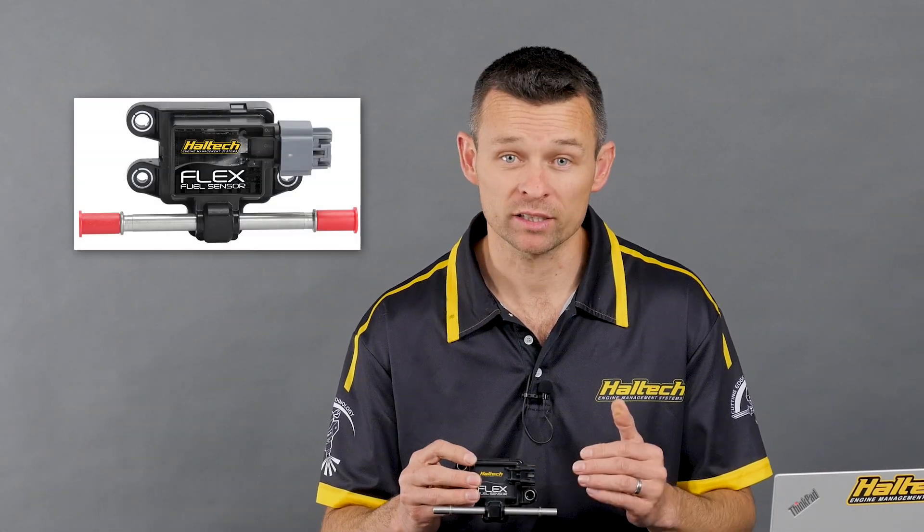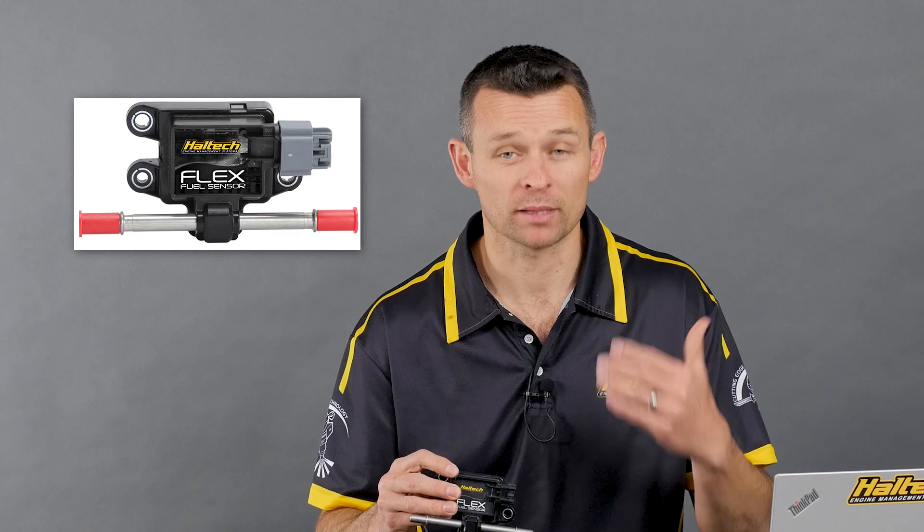And once that was done, we couldn't go back to gasoline without re-jetting the carb all over again. Now, with EFI, however, we can use a sensor like this — a Haltech Flex Fuel Sensor. When installed into the fuel line, it can measure the actual percentage content of ethanol in the fuel. So if you had half a tank of gasoline and topped it up with 100% ethanol, you'd end up with a 50/50 mix. This sensor is able to read that mix and feed the information into the ECU, which can in turn be tuned to deliver the right amount of fuel — or in carb speak, it's like re-jetting the carb continually based on the actual amount of ethanol in the fuel line.